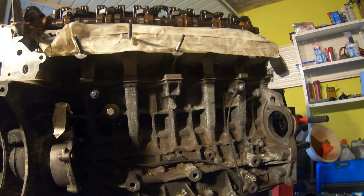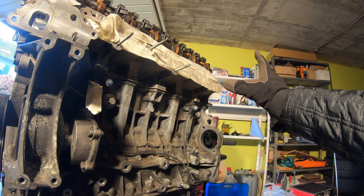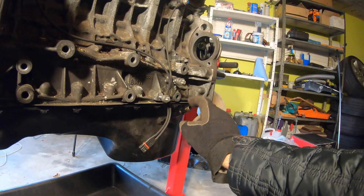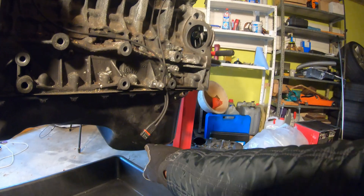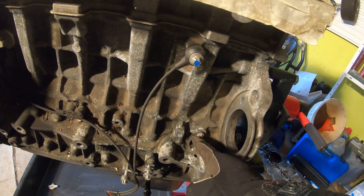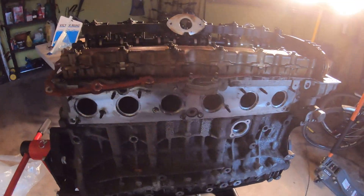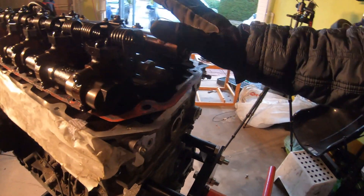On the right side of the block, underneath the intake, you'll have your CCV. If you have an older magnesium valve cover, the CCV is here with a hose going from the back of the engine to the CCV and then down to the lower CCV hose. This can go bad — it goes bad all the time; I had mine go bad probably once every year. If you have a leak going down onto your oil pan, that's one area to check. There's also a tiny sensor here that could potentially leak, but I highly doubt it as it's not under any pressure.